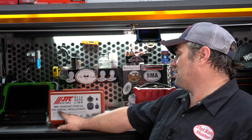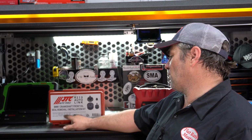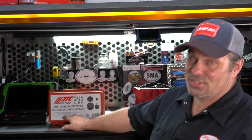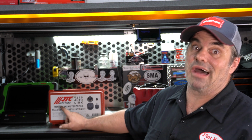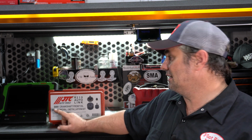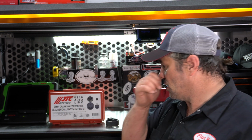All right, next tool is by JTC. It is a BMW crankshaft front oil seal remover and installer for N40, N42, N45, N45T, N46, N46T, N52, N53, and N54. And I can tell you for a fact, if you're working on BMWs and they need a crank seal, you need this tool. That seal is a mother to get out. And installing it, it doesn't want to go in without this tool. So JTC is a Taiwanese company. They have a truck that comes by for us, but it's available on Amazon.